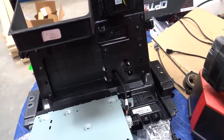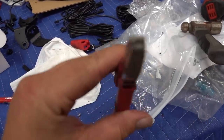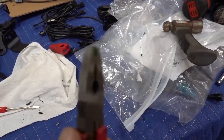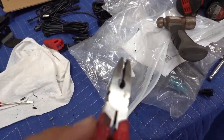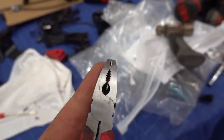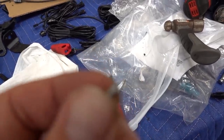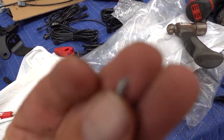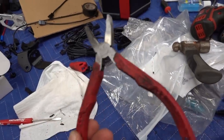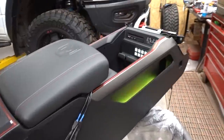With a little help from my Vampliers — they have these little barbs on the end that can grip a rounded-off or small screw — I put that broken stud piece inside the nut, was able to hold it, and then ran the nut off with a wrench and was able to save it. I got that little piece right out of there. I'll have the Vampliers linked in the description — definitely something handy to have in your toolbox.